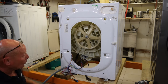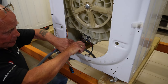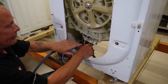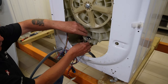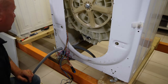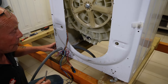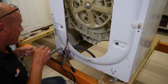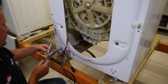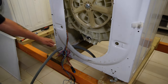While we're at the back, we're going to remove the heater. I'm just going to cut these cable ties to get the wiring out of the way, then pull off the two wires. In the middle is the NTC sensor — this is what controls the temperature. Then I'll pull the earth off — that looks like an 8mm socket. Correction: that is an 8mm.